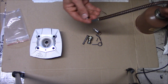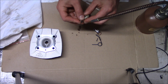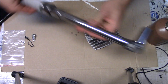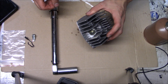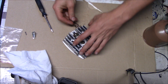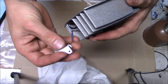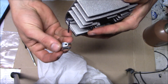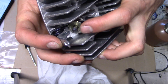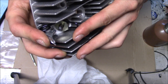Going ahead and getting the decomp assembled. The decomp is going to get torqued to the cylinder head to 27 foot-pounds. Next the spring goes into place, then the little lever — that hole goes on the spring and I need to make sure the holes in the valve stem are aligned with these little holes on those ears. Then I'm going to force this down and slide the pin into place.